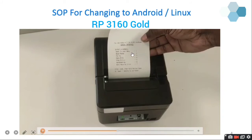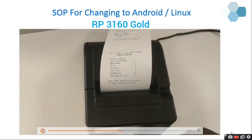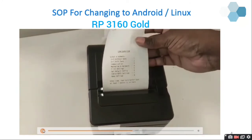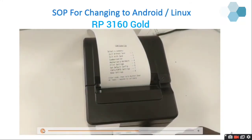Now we can save the settings. To save, go to the last menu and then save. To go to the last menu, press the feed button one time and then the second time long press. It came back to the configuration menu. You can see Exit Without Save and Exit With Save — we need to select Exit With Save, which is the second option. Press the feed button two times and then the third time long press to save the settings permanently.